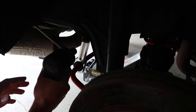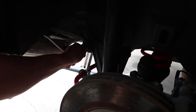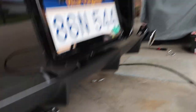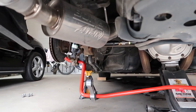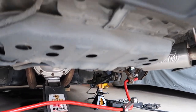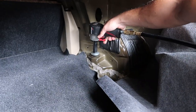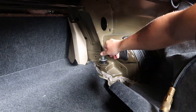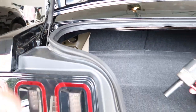First thing you want to do — take apart the top of the sway bar right there, that little mount. We need to jack up the whole differential so it's compressed. That way the sway bar will come off easy and there's no injuries. Then lower the sway bar and take the top nuts off the shocks. Back in the day we didn't have a good air compressor so it took forever — it's so much faster now.